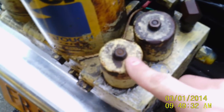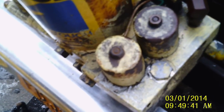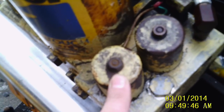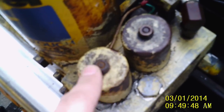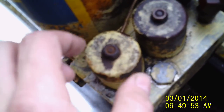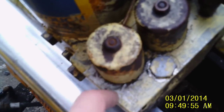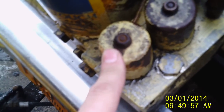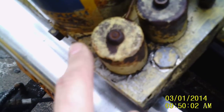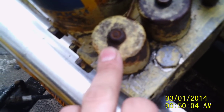Now you will have three different valves. This valve right here, this one here, and then there's one right back there. This valve here with the red wire going into it is called your B coil. Once you take the nut off, it slides off and there's a valve underneath it. This one controls the raising of your plow — so if your plow is not lifting, that could be the issue.